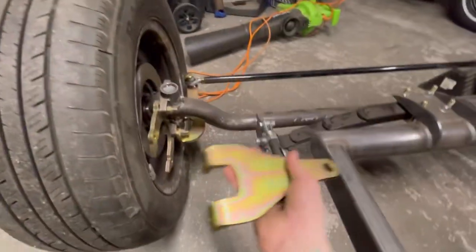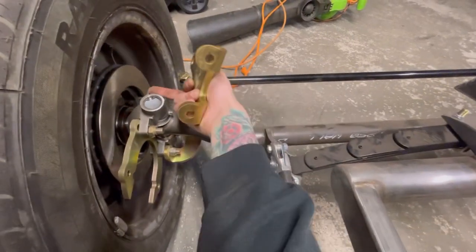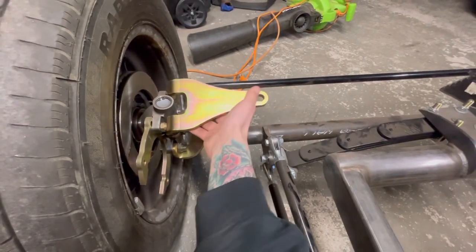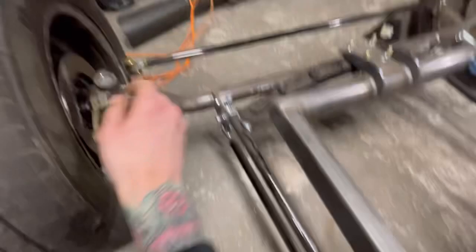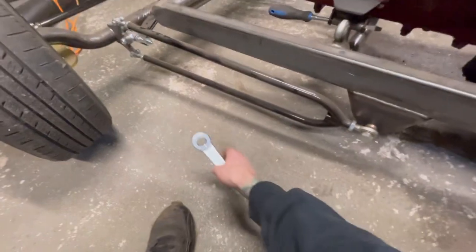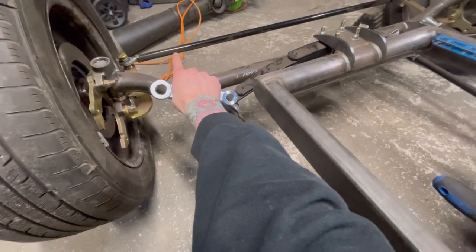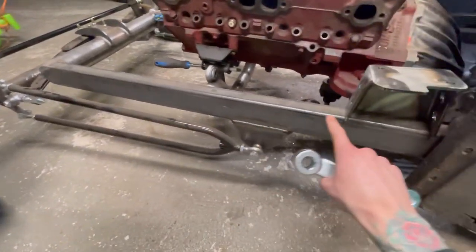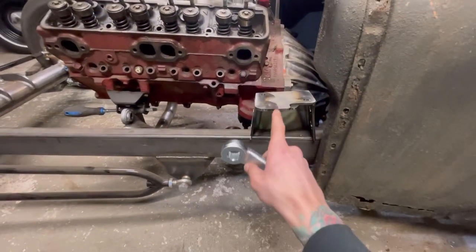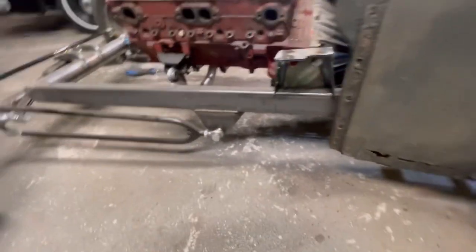This came in the other day. It's a straight mount. So essentially I've got to grab a bolt for that. This will bolt in here like so. The Heim joint will go there with a 5/8 bolt. And then I'll have a rod that runs straight to the steering, which, I mean, that rod's probably going to be roughly this high if I run it on top. This is probably going to be somewhere around there. It's probably going to be pretty close. I might have to cut this and adjust it height-wise to figure out how I'm going to run it.